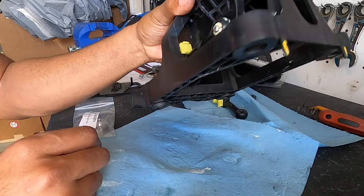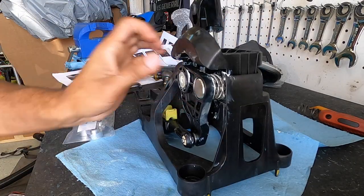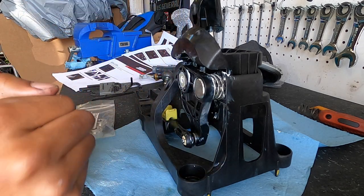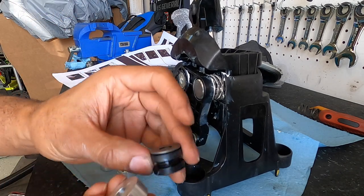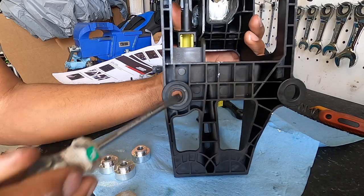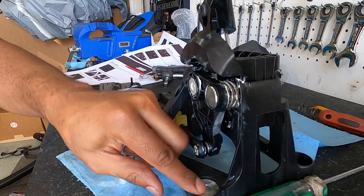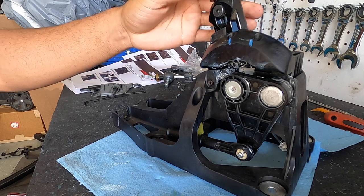This is a good time to replace the shifter bushings. At the bottom of the shifter bracket there are four mounting spots. The stock bushings are a metal collar surrounded by rubber that absorbs shock when shifting — but for a nice crisp shift you want a firm base. The new bushings are aluminum. Push out the center collar with a screwdriver and push the rubber out through the hole, then drop the new aluminum ones in with the lip facing down.